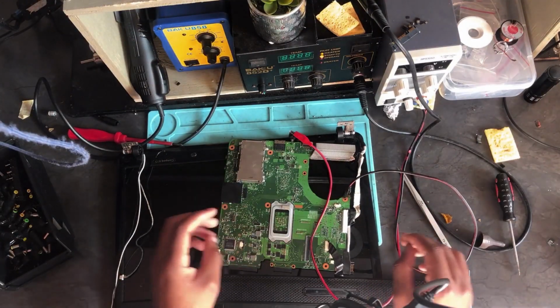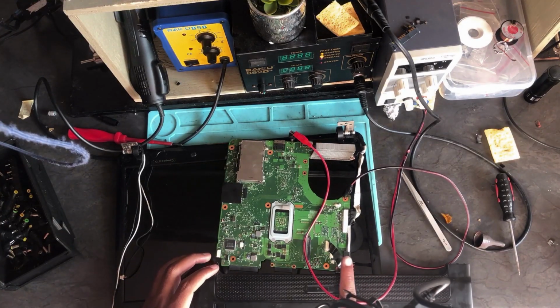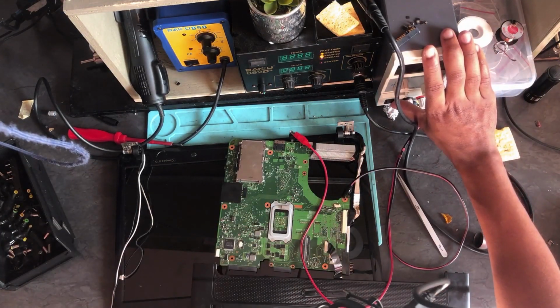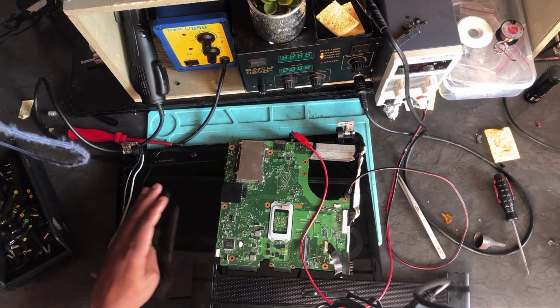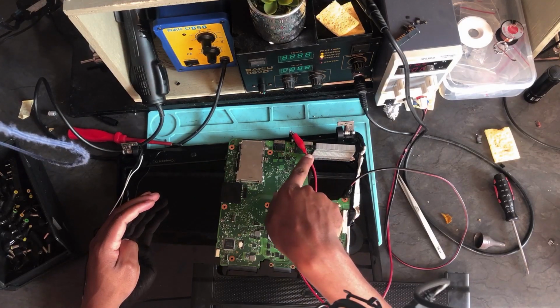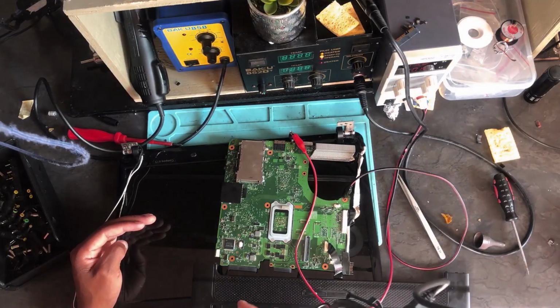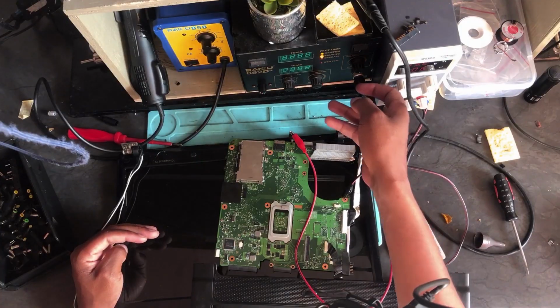Okay guys, let's give it a try. I have the power button here, and yeah, the power button has been connected, and the RAM too. Let's see. Okay, it's turning on, and still there's nothing on the screen, and the caps lock is blinking, meaning for sure the problem here is the BIOS. Now we can flash the BIOS. Let's go ahead.